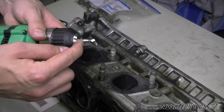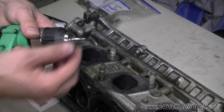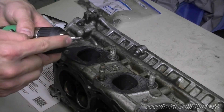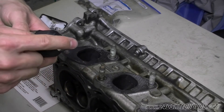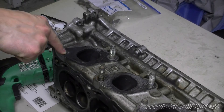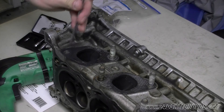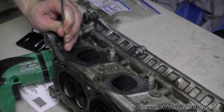What you've got to do is install your extractor into your drill, put your drill in reverse. This little part right here actually slides back a little bit away from the drill bit because the drill bit is on the end there. First thing you want to do is punch a hole right in the center of the stud. If you don't have a punch, you can use a flat-head screwdriver — put it right in the center and hit it with a hammer.